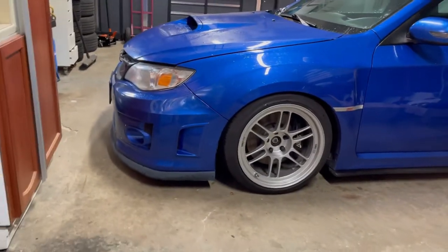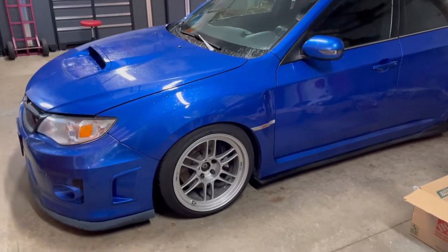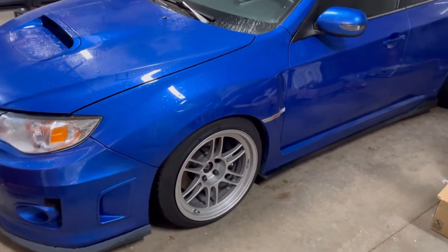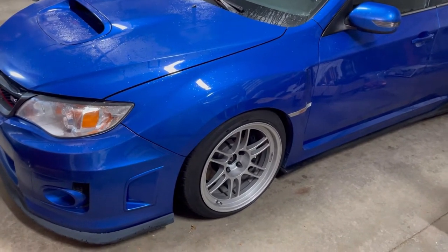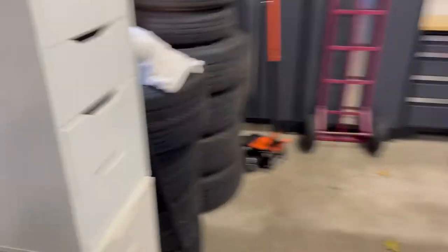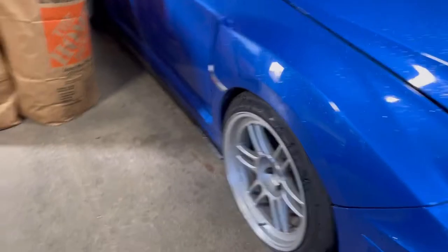The car is fairly low to the ground. To be honest, next season I'll probably go a bit lower in the front, but at this point — end of the season — I just didn't bother. So really what I'm going to do today is raise the car up quickly, adjust the coils up a little bit, adjust the camber so it sits neutral, and put on the stock wheels with some new winter rubber.